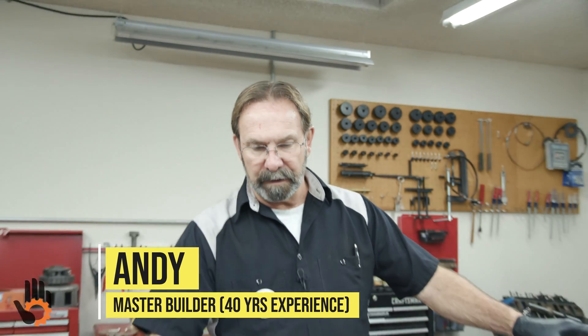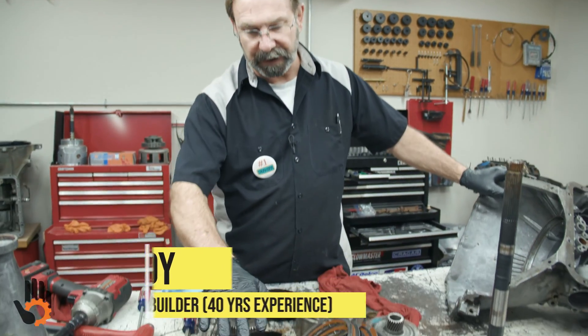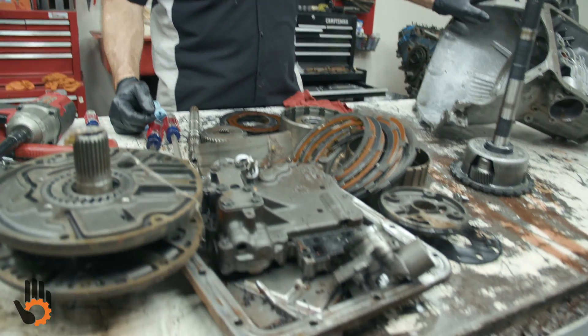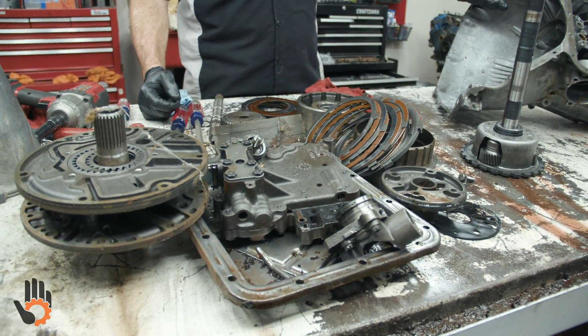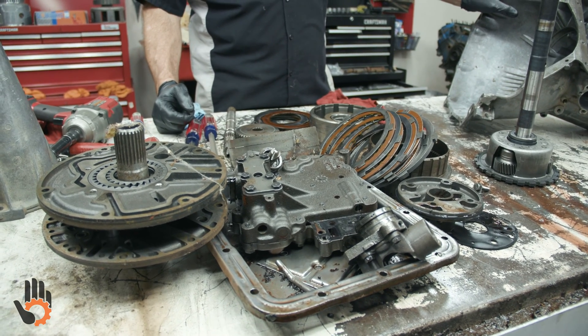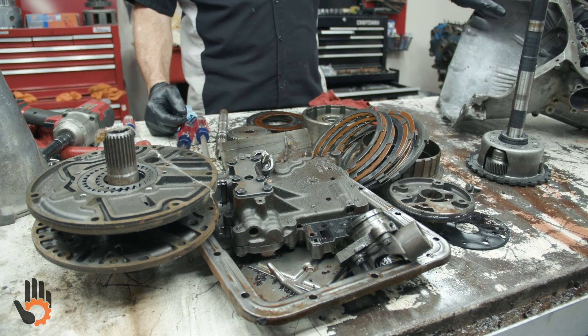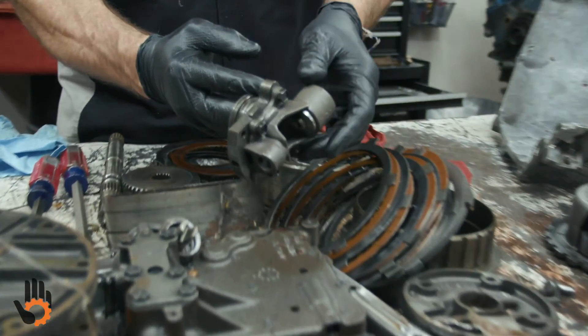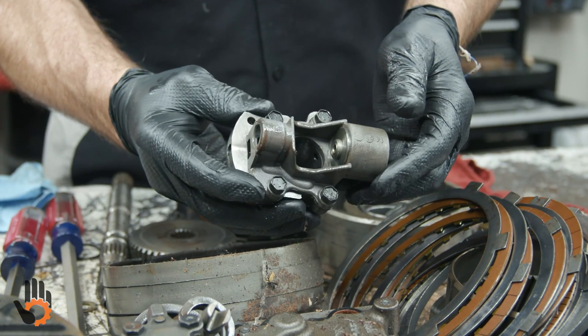We'll do a little inspection of our aluminum Powerglide here — pretty straightforward. The valve body itself, we would split that and clean it all up. Usually not a problem on the Powerglide. You've got a cast iron valve body with steel valves; they didn't really tend to stick much or create much of a problem. The governor itself, I would spend some more time on than the valve body.